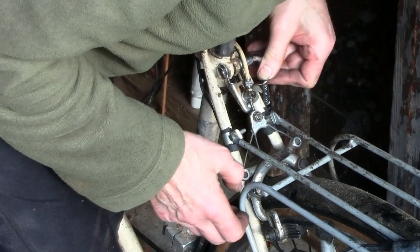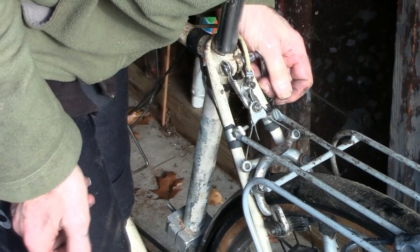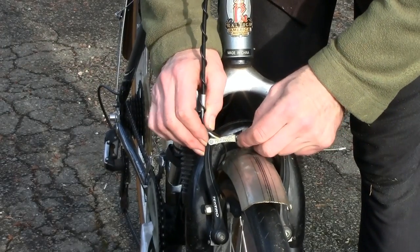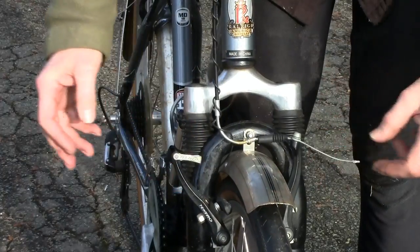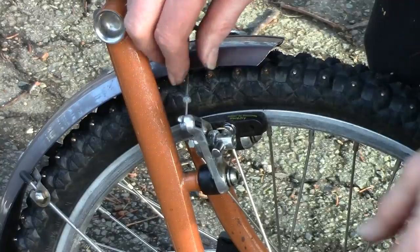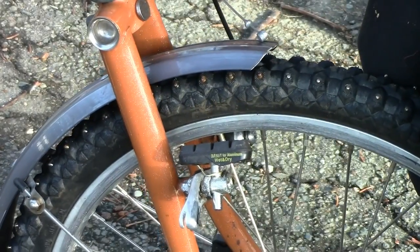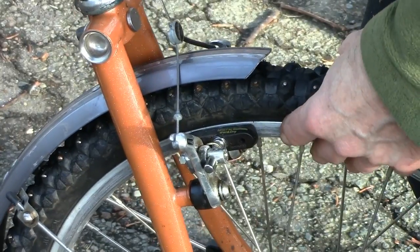If re-tightening is hard, you might use a hand to pull up on the yoke and transverse cable. A direct pull brake, also called a V-brake, releases by disconnecting the part colorfully called the noodle. With most traditional cantilever brakes, the cable detaches from one of the arms. Be sure to reconnect the brakes before you go riding.